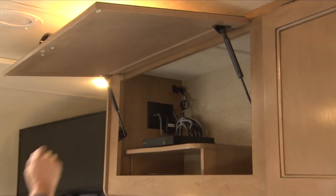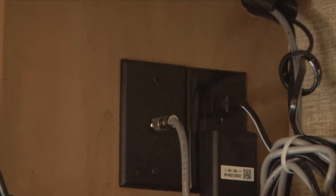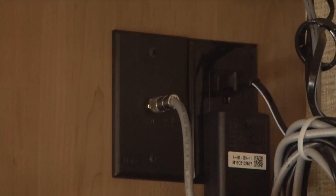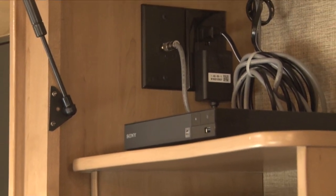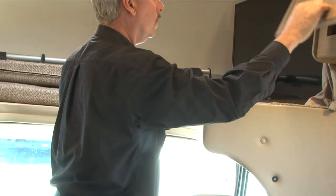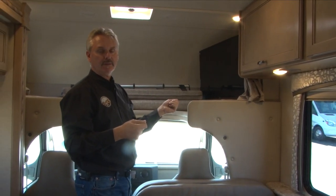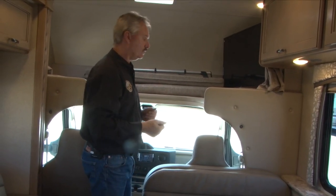Up on the side where the cable's connected, there's a tiny little button. You want to have that button pushed in and have a green light on for broadcast TV. Have that button out for cable or for DVD. Otherwise, everything there will run. You'll have to go into the menu for the TV, tell it what your source is or your input, depending on how it's labeled, and then have it search for channels so that it knows what it has in your area.